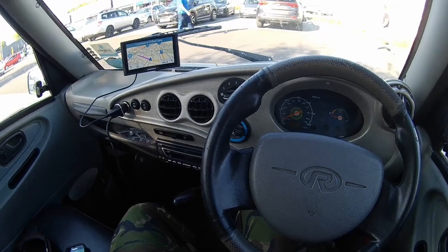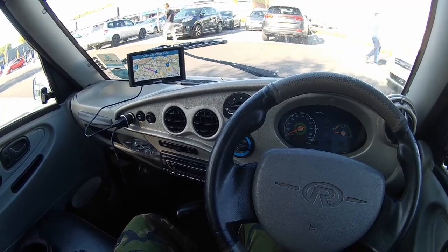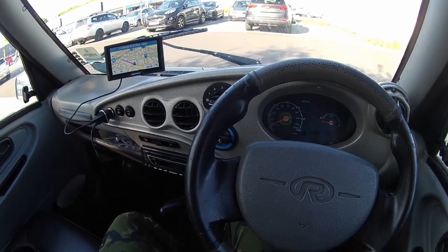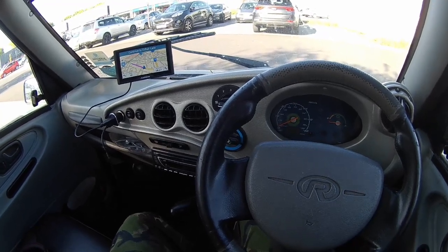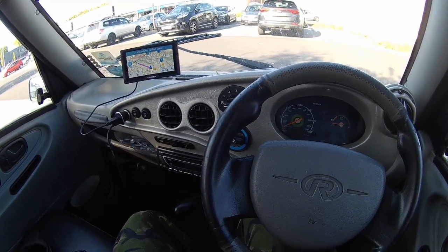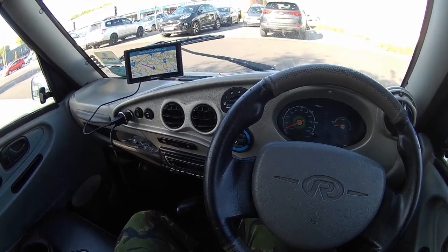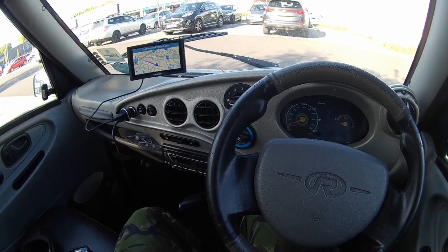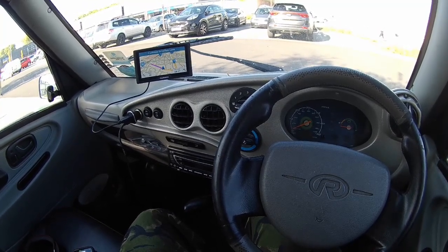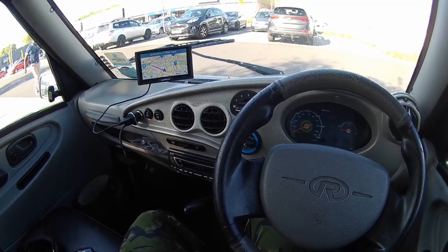I reckon 130 miles foot-to-the-floor is what I expect out of this car. Driving carefully and below 40 miles an hour, I would assume I can reach 150 miles. The ranges are about the same as on the DC except I'm getting a higher average speed and better efficiency from the AC motor, including regen which I hardly used on the motorway. So if I'm driving down country roads and using the regen more I should likely achieve 150 to 160 miles on the packs.